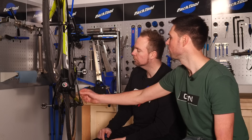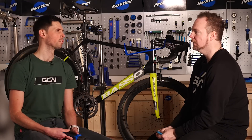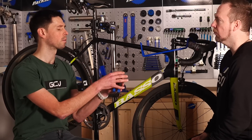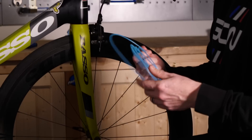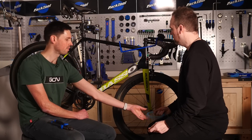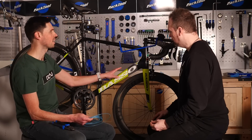We're going to lower the bike back down and replicate the process for the back section, but on the down tube section which runs all the way up to the lever and the head tube. I forgot one very crucial tool: cable cutters. A good quality set like these will last a very long time and give a clean cut on the cable rather than fraying the ends, making life easier when fitting the cable back through. We'll use the inner cable sleeve guide — slide it over the ends of the cable and guide it up through the frame. That way, when we've removed everything, we can leave this inside the frame poking out at each end and guide the new inner cable back through. Otherwise the cable could get lost, tangled, or snagged on stuff inside the frame.